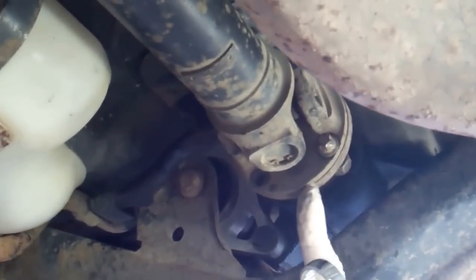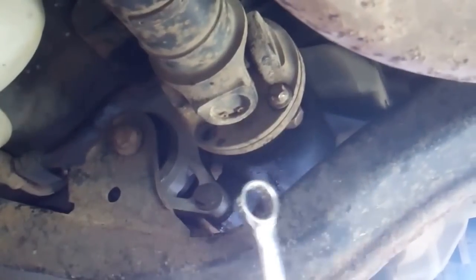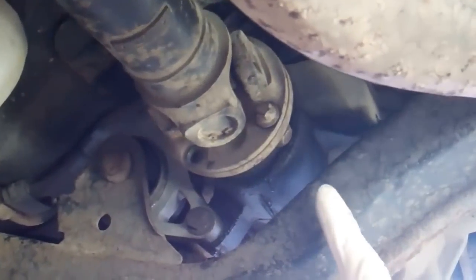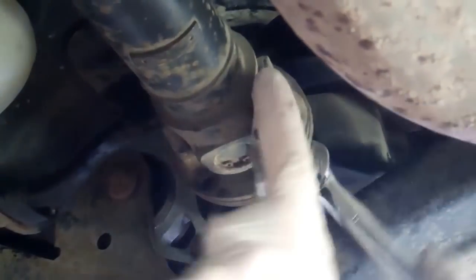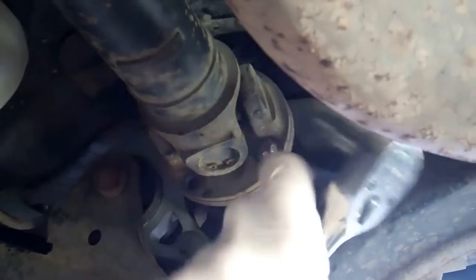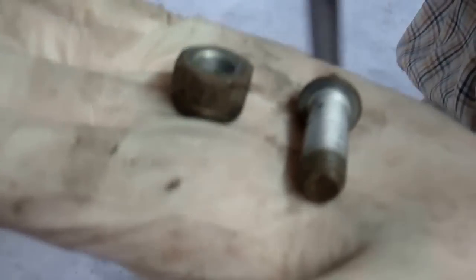Okay, so this is the rear prop shaft joint here. We've got an E12 socket that we need on that one, and then we've got a 17mm spanner on this nut at the back. If you just come around the side, you can see I've loosened it a bit already. So you've got 4 bolts here. Again, we've taken some out to save time on the video. So four of these bolts. There we go. So that's the rear prop shaft bolt. Again, you can see the E-type head on that, and then you've got a nylock 17mm there. So I'll just do that next one.